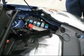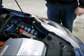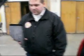One of the features we'll talk about in our PowerPoint presentation are the fuses. In this particular vehicle, one of the things you want to do is secure the HEV fuse — it's a 20-amp fuse located right here. By pulling that, you shut down the high voltage system for this car. This car has about a five-minute lag time where it can still be powered up after you pull the fuse, but by pulling it, you eliminate one of the factors that could hurt us. If you open this up and forget which fuse — HV, HEV, or whatever type it is for that car — just pull them all.